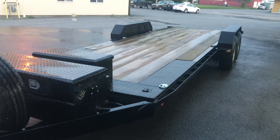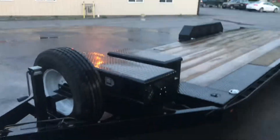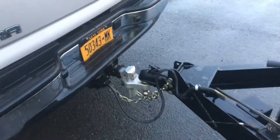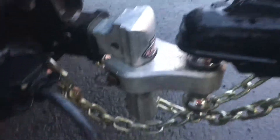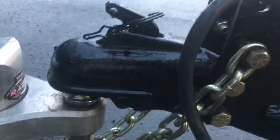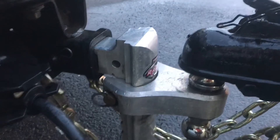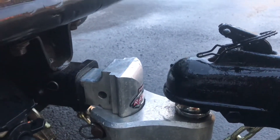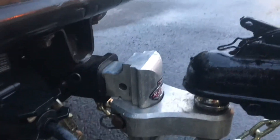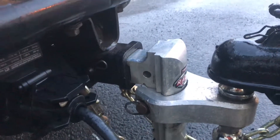It's a tilt deck — we made it a tilt deck. It's got a winch, all that stuff, but that's not what this is about. What we've got here is an adjustable trailer hitch, 2-5/16ths on top, 2 inch on the bottom. You want to use the proper size ball for whatever your coupler is, which in this case is 2-5/16ths. This is a 10,000-pound rated hitch on the 2-5/16ths side, so we're covered there. You always want to have just as much or more hitch rating as you do trailer.